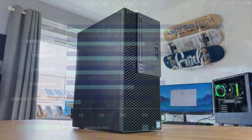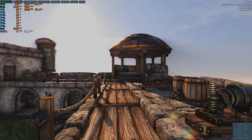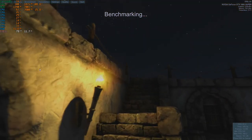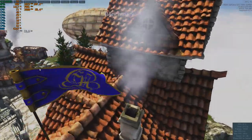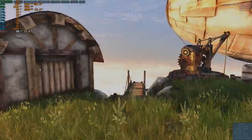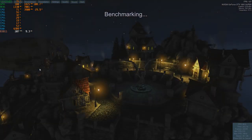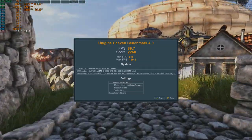You shouldn't have to go as low as performance mode with 8th gen Intel and an i5. That's the video today folks — I hope you enjoyed taking a look at this Dell. We had some fun with it and did have to get a bit janky with undervolting the GPU to meet the power requirements, but I had no issues. The GPU was running at about 100 watts and total system power consumption was about just under 200 watts, peaking just over at some points. It's amazing what you can do with a small budget in 2023. Please leave a like or a comment, consider subscribing — take care, God bless and I'll see you in the next one.